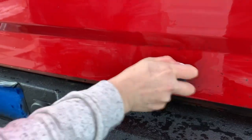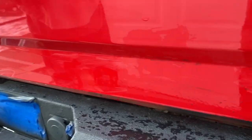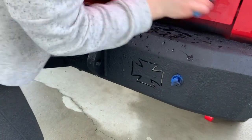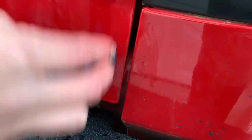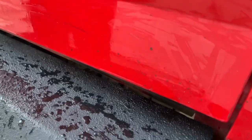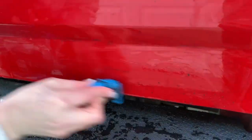And the whole process — that other side took me less than 10 minutes, this whole side. So if you get overspray, or if you want to do a rhino liner and you don't want to have to take off your bumpers to do it, I would suggest you do take them off because you can't get into the crevices. But if you're doing a touch-up, that's what happened with us — we had it done and then we were just doing a touch-up and this came up here. To avoid this, make sure you tape off your appropriate areas.